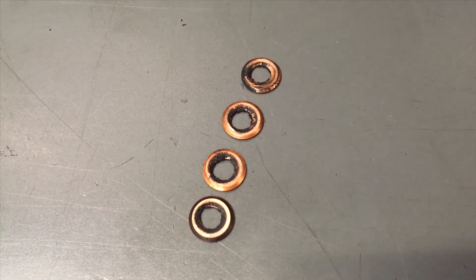You time your work for when the seats need replacing and the injectors need replacing, and while you're in there doing that, you check your valve clearances and everything else you want to do. It's a good time to do it around the timing belt, because if you need to adjust valves your timing belt or camshafts have to come out. I don't worry about doing it at the same time as the timing belt because we don't see valve clearances out — they're always very close to the minimum end of spec, usually within about 100,000 Ks, especially if you've got an EGR solution.